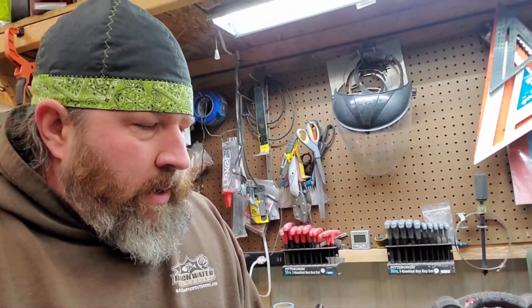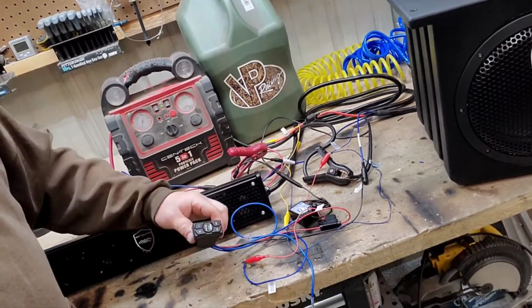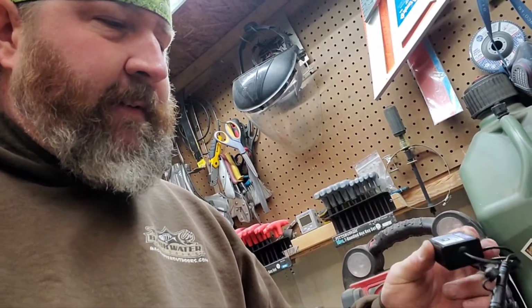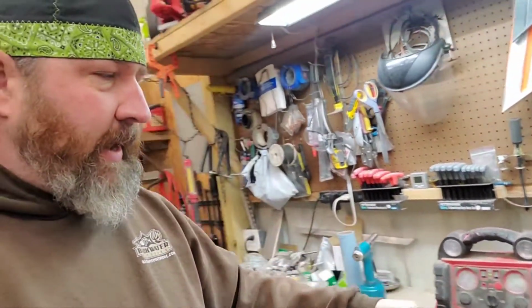It's plug and play, man. Comes with roll bar mounts, comes with whatever kind of mount that you want. Don't be overwhelmed by this, because that's all the wires from this and from this and from this. They're all color coded. They're all very well labeled, and well, they work. Now, we did add one more thing to this, and this is a little 3.5 millimeter filter, the PAC 3.5 high pass filter. It just clarifies the signal, and it's a noticeable difference. The only other thing that we added to the system is a splitter to be able to split the signal, because the 3.5 millimeter that comes off of that has to go to the bass and the sound bar.